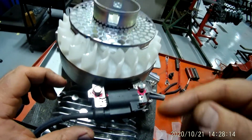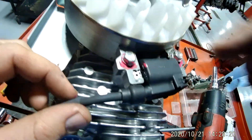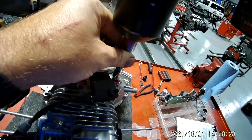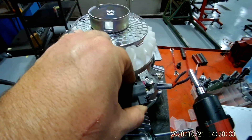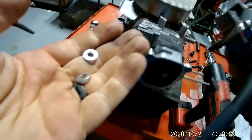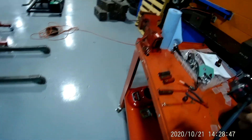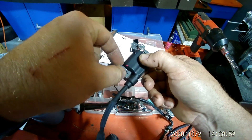One thing I did was I took some fingernail polish and I painted it around the sides — that's going to give me an idea about where it's going to be. Now I've already taken this thing off, and there are two flat washers you don't want to lose sitting underneath of it. These two washers are thicker than a normal washer, so you can't just go put normal washers in there — it needs to be that thickness for this to work correctly.